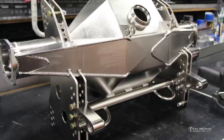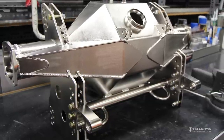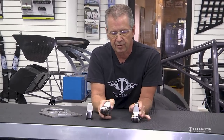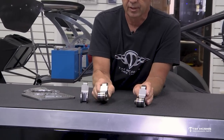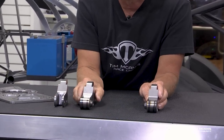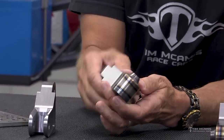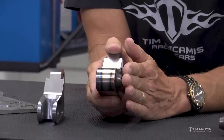The slightest bit of flex will create problems and ill performance in how the car handles. It's cheaper and easier to build these out of aluminum and you don't need plating, but the benefits of steel far outweigh that. These raw steel parts will need plating for corrosion resistance when you plate the housing. This is the center mount; this other one is an inset or offset mount. A normal setup for us is inset like this, with a threaded bushing pressed in and tapered on the end.